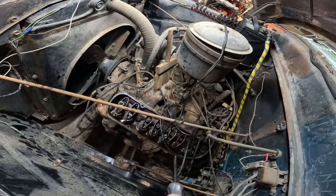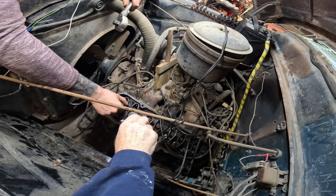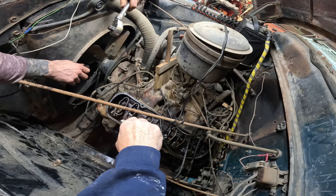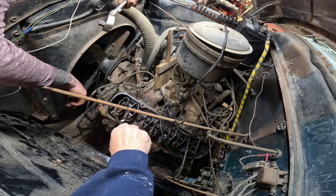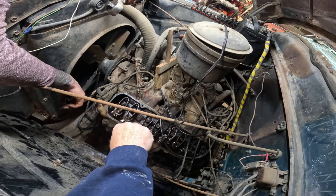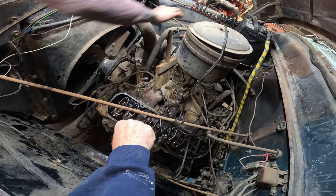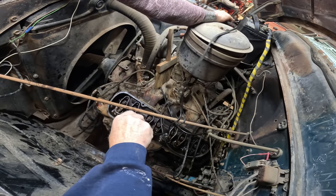Now, here's a good way to tell before you tighten that down. It's pretty obvious that that's up. And that is an exhaust, which doesn't make any difference. If I make it go all the way down and adjust it like that. Well, it does matter, because you want to be on the heel, the furthest away from the lift part of the cam as you can be to make a good adjustment. That's why you always want to be top dead center. No, that's okay. Yeah, go ahead.